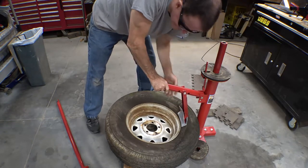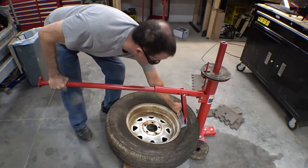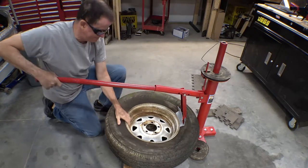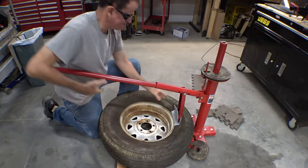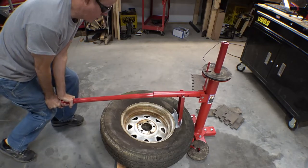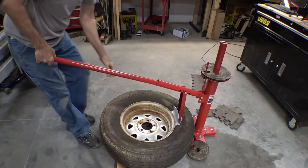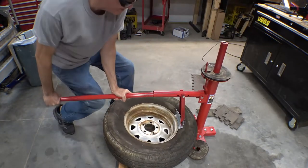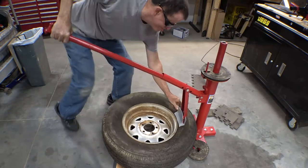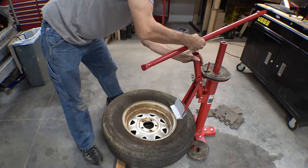Coming up here shortly is where I start bending things. The back bead on a rim is harder to break because the seat is a little bit wider on the back side of the rim and it has a little bit of a safety lip to help keep it from coming off. It takes a little work to pull the bead off the back side. I saw this in other people's videos where this part did bend, so I figured it would need reinforcing. Spraying a little lube into the gap as you start to break this bead helps quite a bit. You usually have to walk it around the bead a little bit and get a couple bites on it to get it loose. That little piece of wire sure helps hold things out of the way.